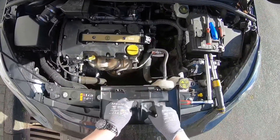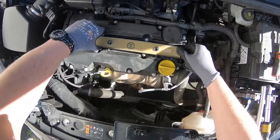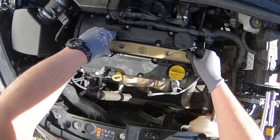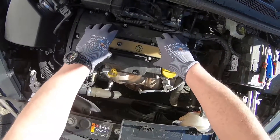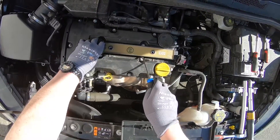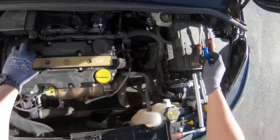Now it's shake-it time, because we have to dance with the ignition coil until it can be removed. You can buy a special tool for this too, but you do not need it. You have to shake it, lift it, and tilt it a little bit. After about two minutes of shaking, you use a small flat screwdriver — gently — and then you are ready to remove the ignition coil.